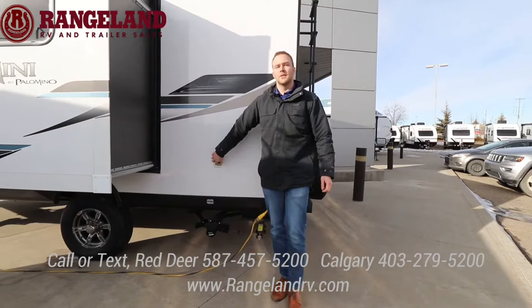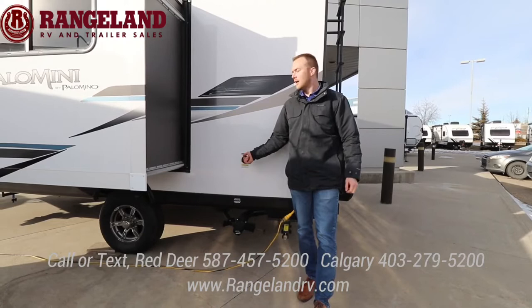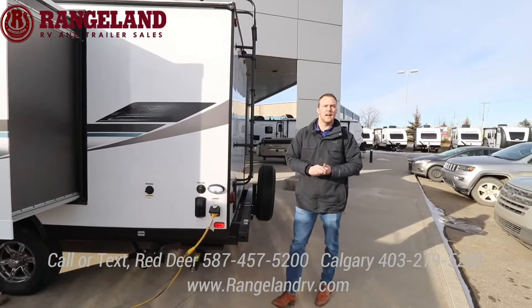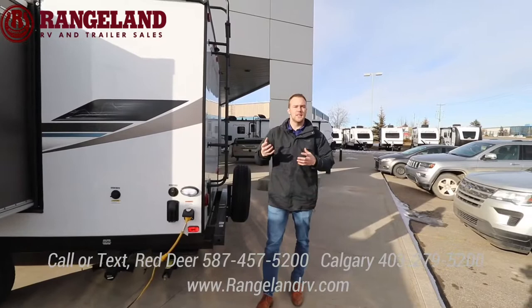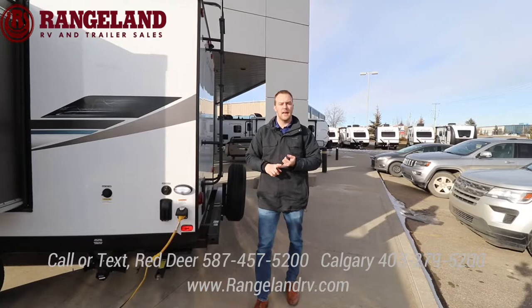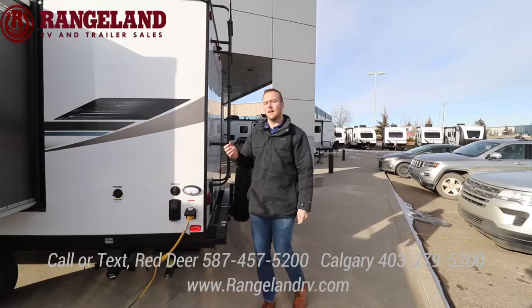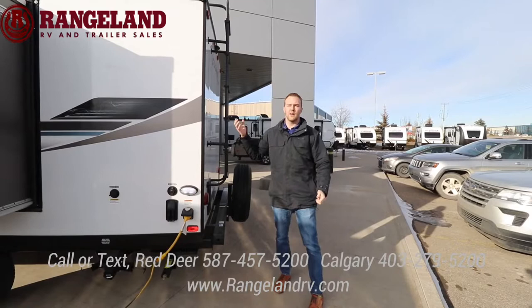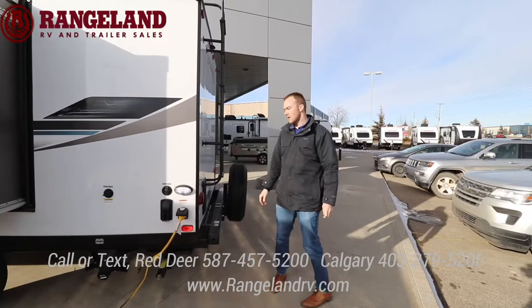Standard is your black tank flush. When you're hooked up to a sewer site or going to dump, you hook your water hose up there and it flushes out — like a dishwasher for your black tank, leaving things much cleaner. On the rooftop there's a standard roof rack — kind of like a Thule system on your car. You can add a kayak carrier, bike rack, extra storage container, or snowboard rack if you take it out in the winter. The roof membrane itself is a TPO membrane, which is stronger, more durable, and thicker than vinyl or rubber — they're building it knowing you'll be using that roof rack and solar options up there.